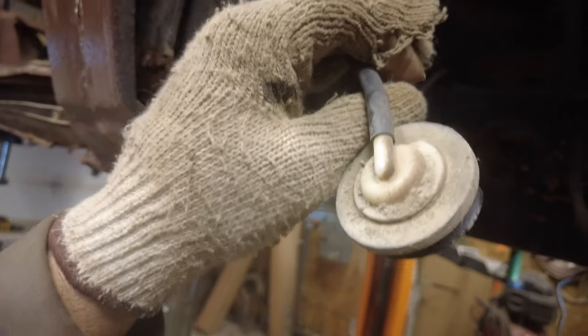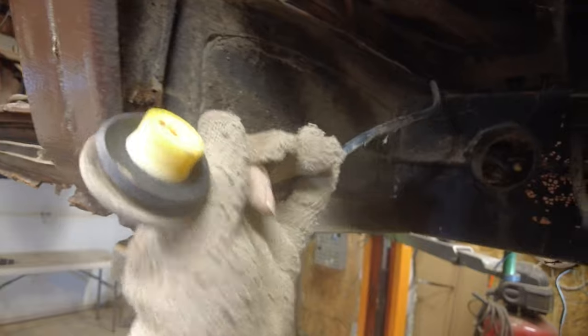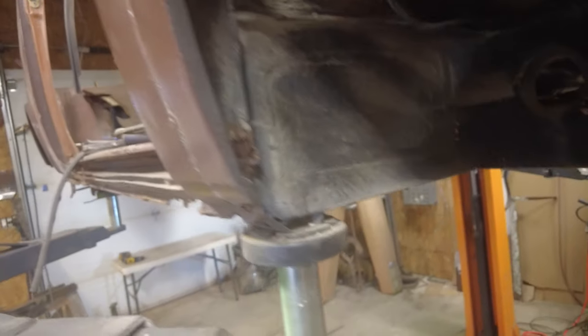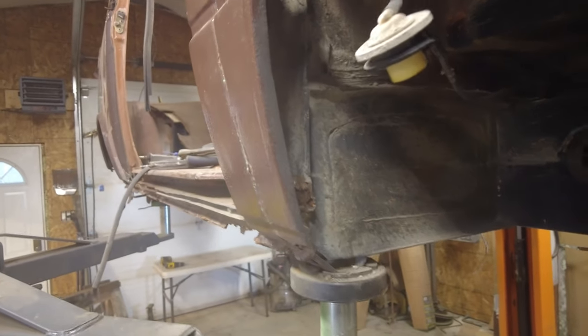What about those plastic cans? Now up here there's one bolt, I don't know if you can see that, it's kind of dark in there, and then it sort of pressure fits into the wall right there. And this thing here is a one-way valve, so if the car gets tipped upside down, this is supposed to close. It doesn't seem to do that, so I guess I've got to find replacements for them. I'll see what I can do. Try the other side, see if it works.